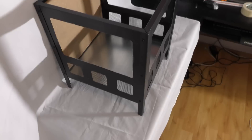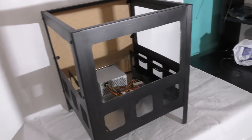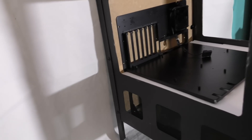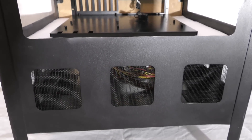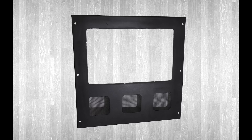I've sanded all the edges so it's nice and smooth, and that bottom section will house the power supplies, 2 pumps and 2 radiators. You will see soon that we have another section on top which will house other computer components — the motherboard, motherboard tray — and I will be running with 2 reservoirs in this build. The idea is to go with a couple of through-panel fittings so I can get a nice clean look, and most of the piping will be going down beside the motherboard tray with a couple of tubes in front.